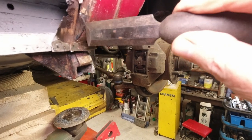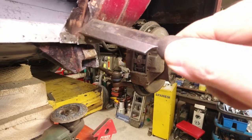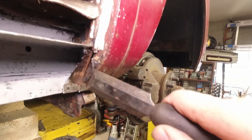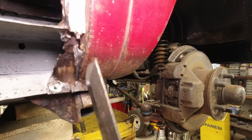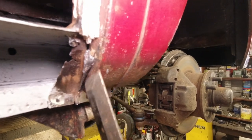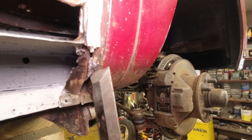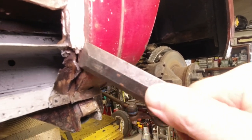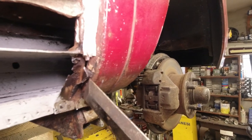Look, you just take it down, and that's how easy it is. There's no hammering going on here at the minute, you'll notice. And I'm peeling it, look. We haven't gone at the B post. So you just take it down till you see it kind of turning blue. Did you hear that click? That's what we're talking about. And that way you do no damage and you're not taking metal off where you don't want to take metal off.